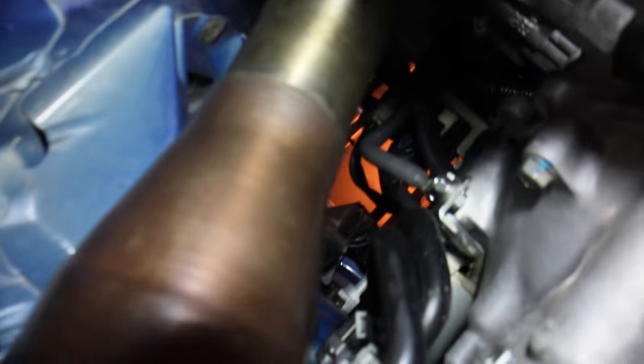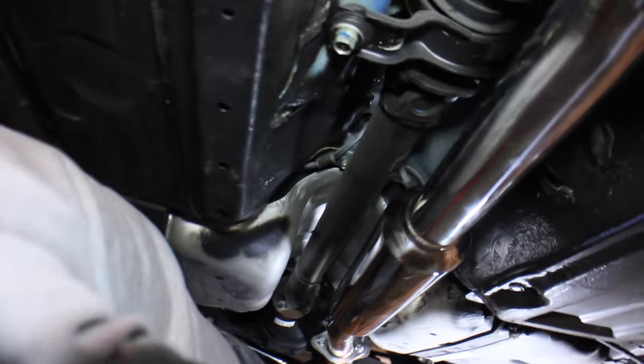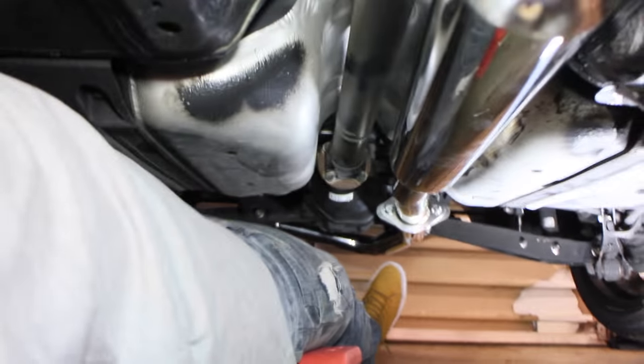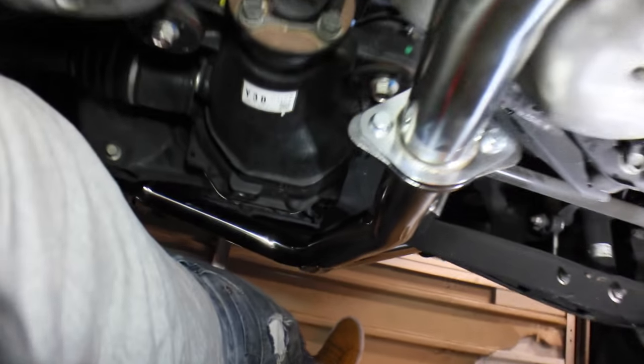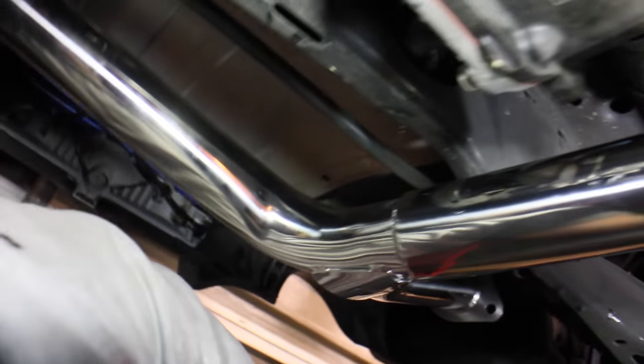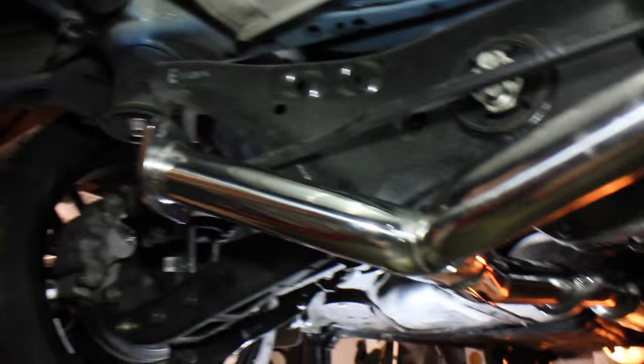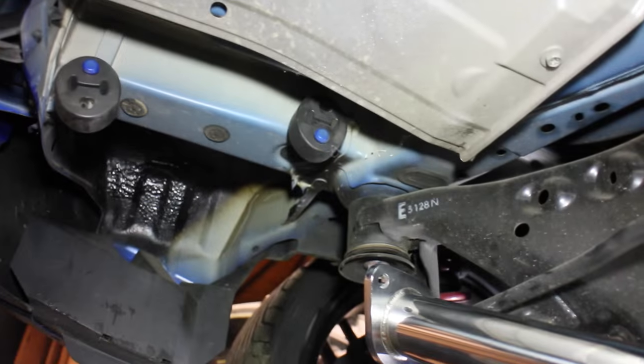You have the Nameless Performance connected to the exhaust manifold, overpipe and cat. Then you can see the rest of our exhaust - that's where the Nameless ends, then we go into our resonator. That's our Zeta - resonator down to a Y-pipe for our dual exhaust. So we bolt it up - shiny - and that has a hook right there, and that's where it hooks up, that's how it all holds on there. Then our Y-pipes go up, we've got to put our muffling canister on, and it has four attachment points. Then we'll be able to light this candle and see how it sounds.